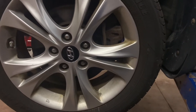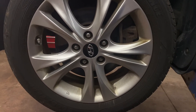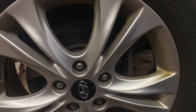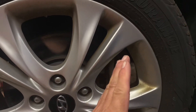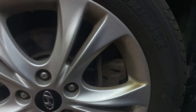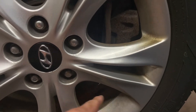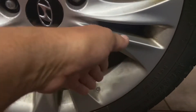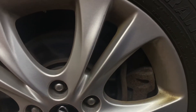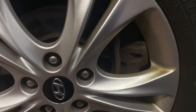You know what happens when you don't tighten up your caliper bracket bolts or even your caliper bolt, especially if it's the top one? When you go in reverse and hit your brakes, the caliper shifts and hits the inside of the rim and locks it up. And if the top bolt came out and you apply your brakes, it does the opposite — you can't go forward.